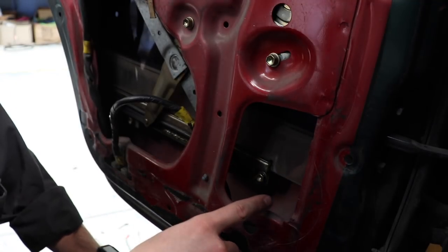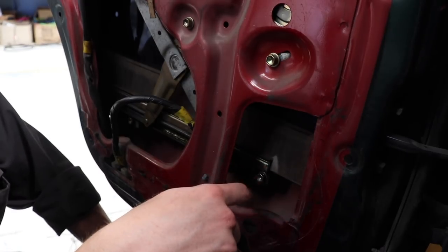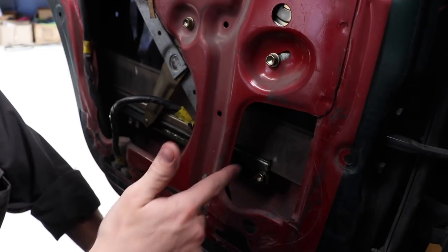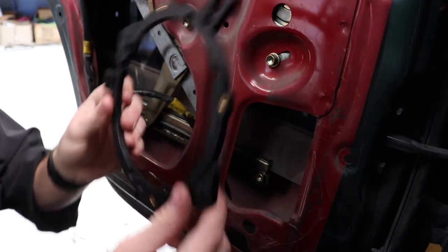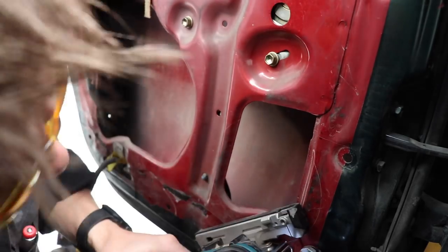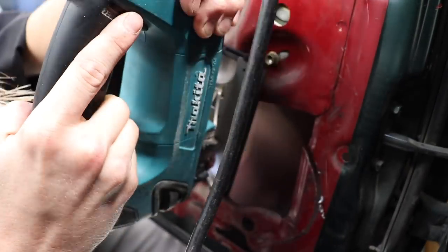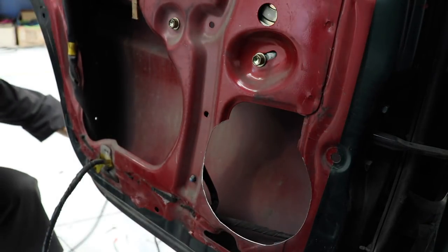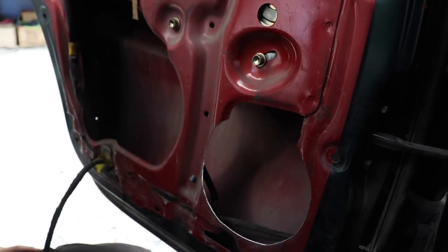And to make the hole on the door card line up with this, I'll show you in a minute. Basically, I take a random stab, knowing I'm pretty well going to get it in this hole, and then I use my knife and cut down until I feel metal. I do the same horizontally, and that gives me the most outer points, and I can line this up on it and cut the circle. You'll see. Here we go. There's my hole. Just double check it's, yep, that's good. Sweet as. That's what I need to do now.